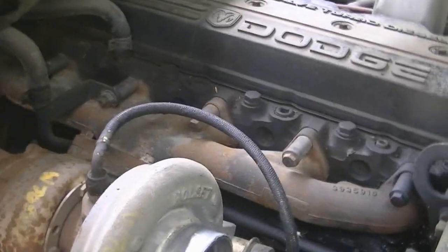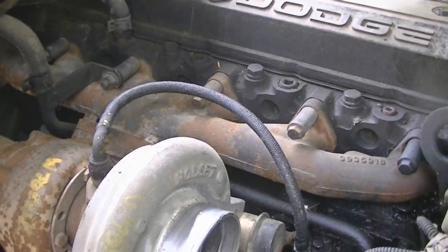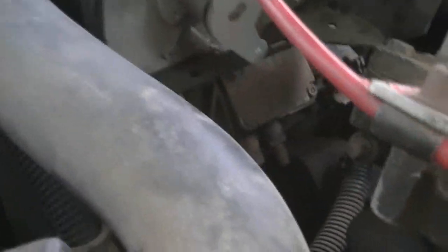If I pull that out and there's nothing to bite to, I've got to remove the manifold anyway and then I'll drill and tap it that way — so I don't get filings or anything into the turbo or into the engine. The wiring's all cleaned up, you can see all the spaghetti on the ground. First thing I think I'm gonna do is take the intake elbow off — or intake horn, I think is the proper term.